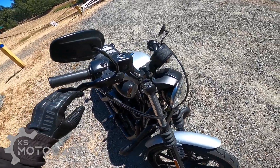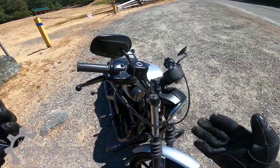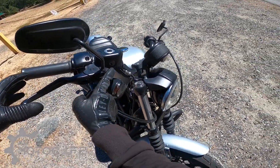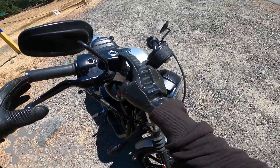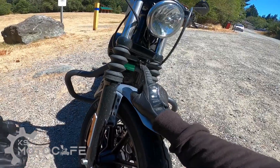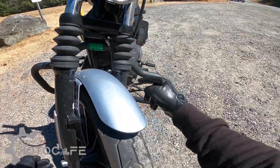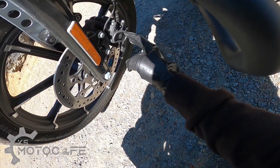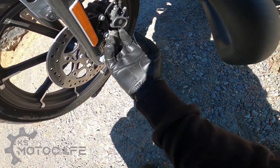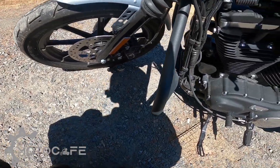Take a look at this — it's our friction ramp of science. On your right handlebar, you have the brake lever and brake fluid reservoir. You as a rider control that brake lever, and when you pull on it, a piston pushes the fluid through the tube. The tube is a closed system — there shouldn't be any leaks. That pressure of the brake fluid travels from your handlebar all the way down to your brake.